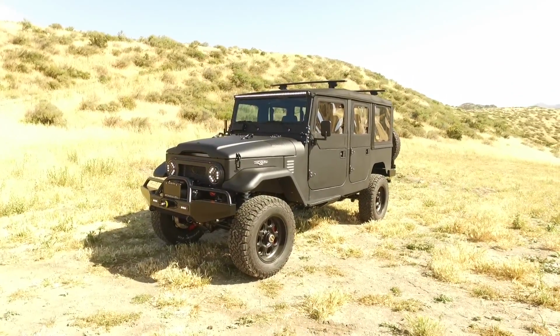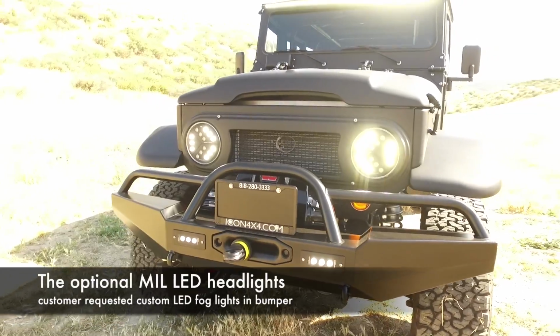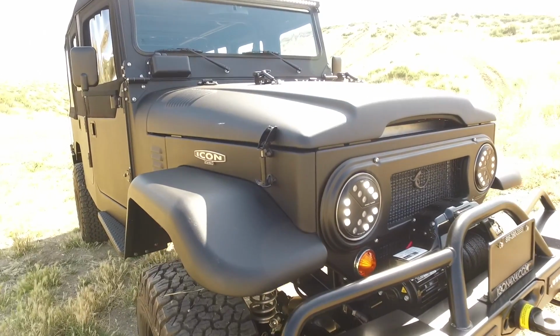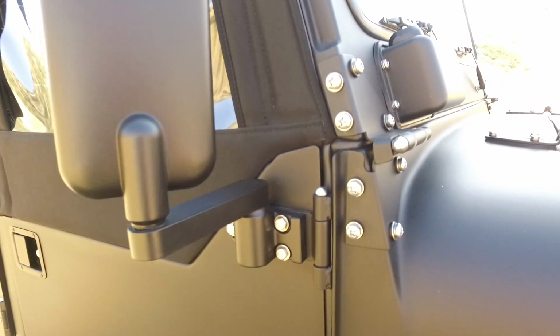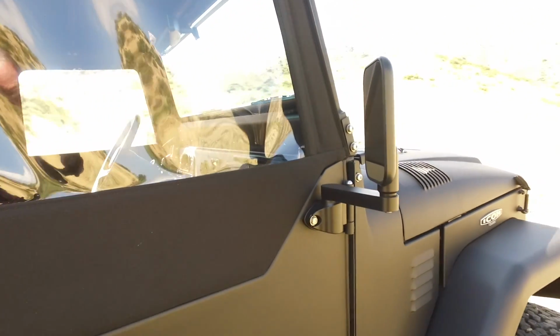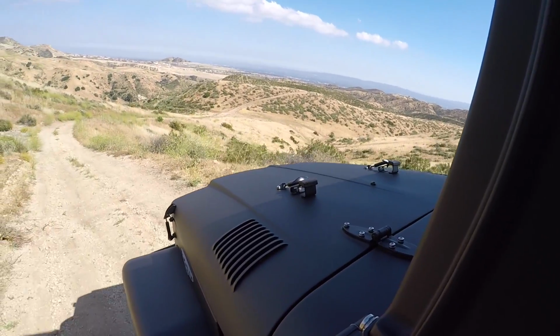Probably its Achilles heel, though, is that since it is a baked-on finish at high heat, it's not applicable to many base metals. Like a traditional car body would just warp to all hell, and that really wouldn't pan out. The other thing is, on an ICON or any powder-coated bodied vehicle, if you screw up a fender or door or some bolt-on part, cakewalk. We literally can ship you the part. You can play Legos and unbolt and bolt on without it ever going to even a body shop. But if you damage the main components like the chassis, then you got to take the whole thing apart and isolate that body part so you can put it in the oven and bake it. Only seen that happen 2 times.